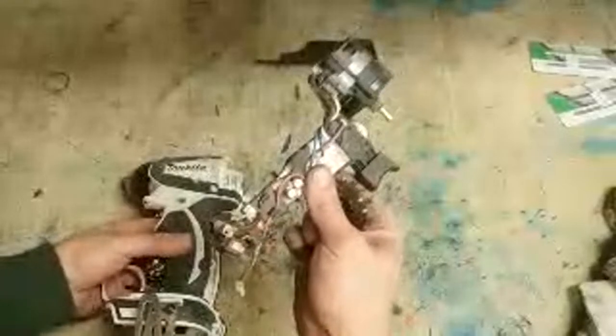Once the controller goes, that's it. It's not going to be worth fixing. The controllers are generally the same price as a new machine. So if you're wondering what's the difference in them, that is it. A brushless machine is brushless. There's no contact. A computer runs it. A brush machine energizes each segment the brush is touching. More simple, more reliable.